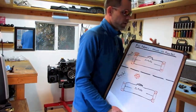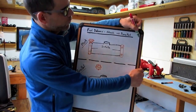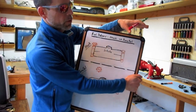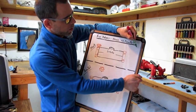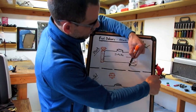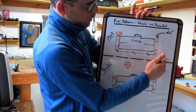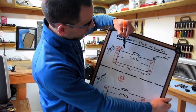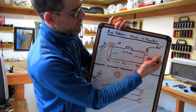This will be the stock system and this will be the parallel. You have a fuel tank in the back of your car, with a pump in the fuel tank. The pump pumps fuel up to the front of the car. In a stock system, that fuel comes into the engine compartment, out of the first fuel rail, then into the second fuel rail, hits a fuel pressure regulator, gets regulated to about 25 or 30 psi, and an outlet from that goes back to your gas tank as your return line.